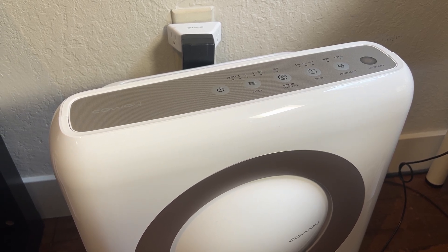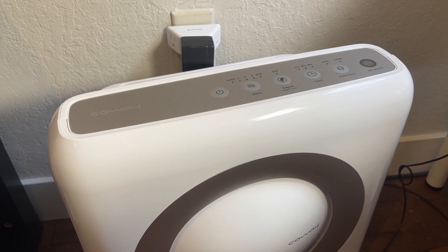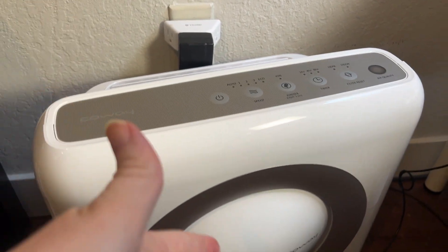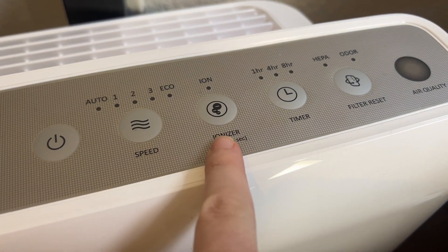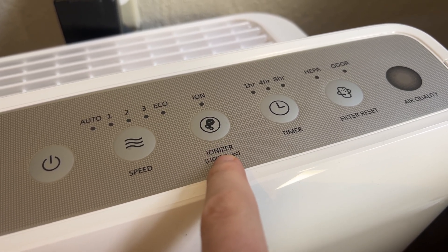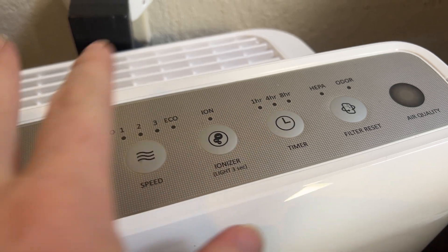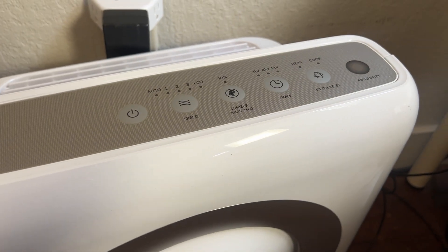So those are the basics of air purifiers. A couple of things that are more advanced features that your purifier might or might not have. Most purifiers are gonna have a fan that pulls the air through — it blasts it out the top once it goes through the filter, comes in dirty, comes back out clean. But some purifiers also have an ionizer. This uses an electric charge to create little charged particles that stick to the dust in the room and help it float down to the ground. This is something that some people like. I don't personally use this that much — I think physical filtration is the most compelling thing with an air purifier — but for some people that's something they are looking for.